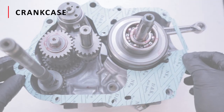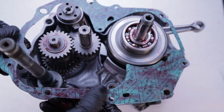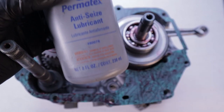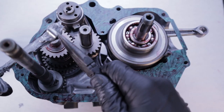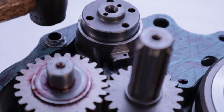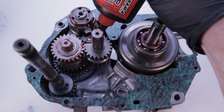Big step — mating the case half. I like to start by just checking the gasket alignment, then with some assembly lube, lightly grease the gasket. Clean the mating surfaces and then install the gasket. Coat the dowel pins with some anti-seize — this stuff is like chewing gum in your hair, so just be careful with it and try to keep your fingers off of it. You may have to tap in the dowel pins a little bit to seat them. Clean the mating surfaces on the right side crankcase half, and then lube the bearing bore just like you did on the other side. Before you drop the other case half on, make sure to lube up the transmission really liberally.